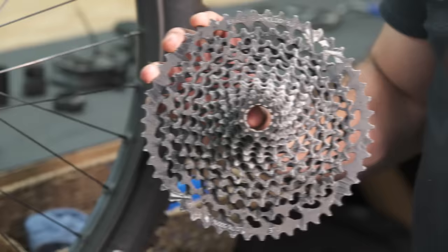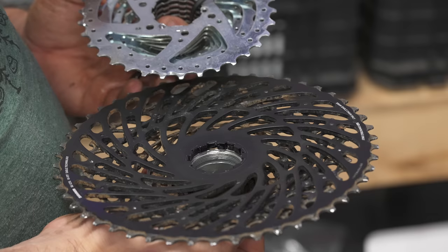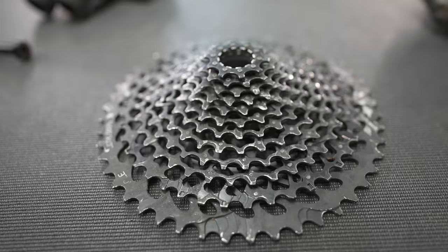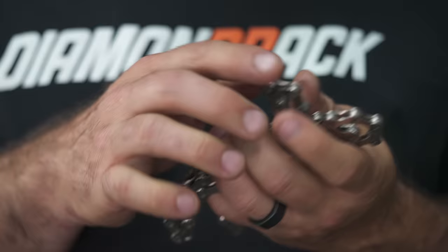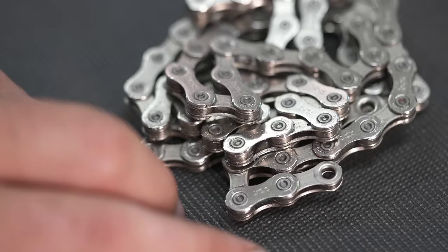On the cassette: first and foremost, make sure whatever cassette you get has the same number of cogs as the old one, or it won't run on your drivetrain. You also need the correct brand — HG cassettes for Shimano, TRP, and MicroShift; XD/SRAM cassettes for SRAM. The number of speeds is the most important thing — this is a 12-speed cassette, so you'll use a 12-speed derailleur, 12-speed shifter, and a 12-speed chain. Chains are actually one of the easiest things to order: just count the cogs in your cassette. 12-speed cassette needs a 12-speed chain, 10-speed needs a 10-speed chain — that's it.